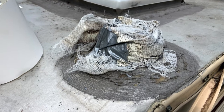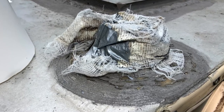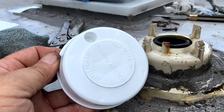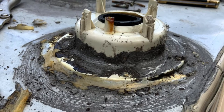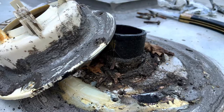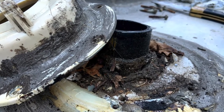As you can see, when the vent cap either broke or got lost, the previous owner, instead of buying a new one for four dollars, wrapped it in duct tape, preventing fumes from venting out of the black tank. As you can see, after taking it apart, it was a mess. It was time for some mineral spirits, some Dicor caulk, and some Eterna Bond tape.